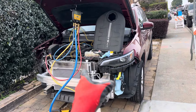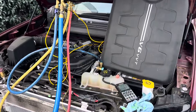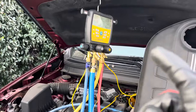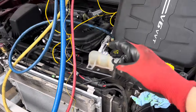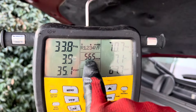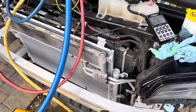Air conditioning on a 2019 Jeep Cherokee Latitude. 480 grams YF refrigerant charge, brand new condenser. It's only 56, 57 degrees outside — that's going off the temperature right here where the air is being sucked in across the condenser.